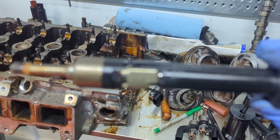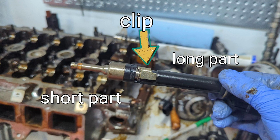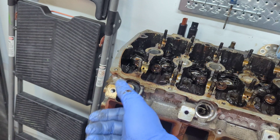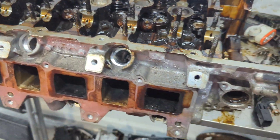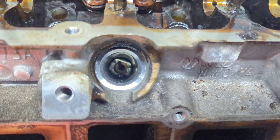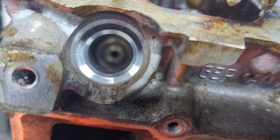On the long side of the head, or the non-short side, this is your typical FSI injector. You'll see that it's two parts. It goes all the way into the head on the far side, just like this — you push it in there, and that's how you squirt into the cylinder. But if you try to pull them out — this has happened to two of the cylinders — if you look inside, you'll see there's a little clip in there. That little clip with the O-ring is bad, and the one that was successful goes all the way down without issue.